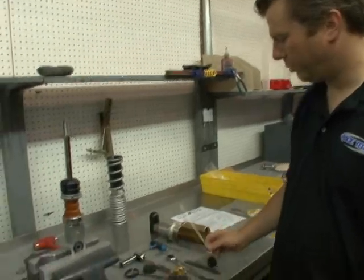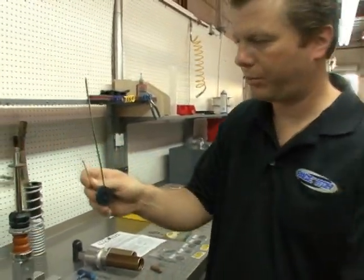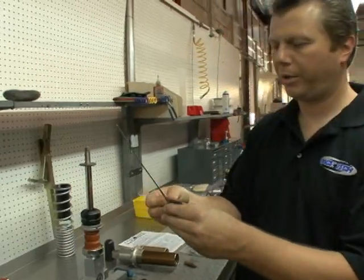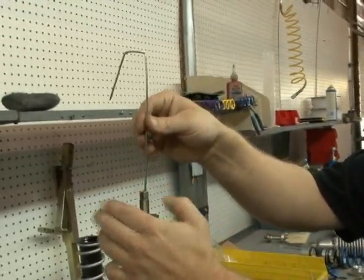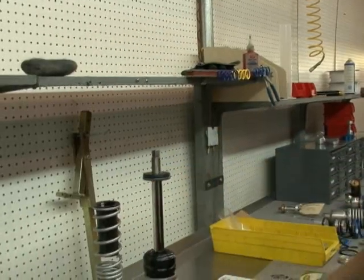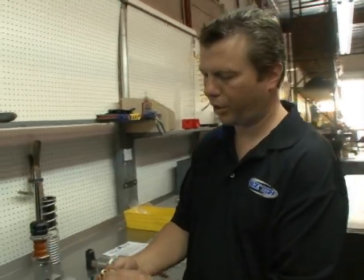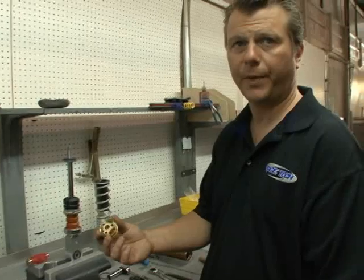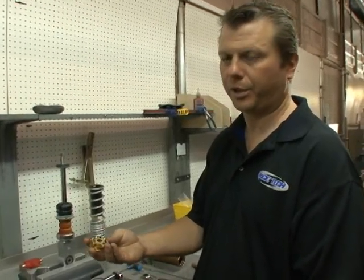At this point we'll assume we've built our valve stacks. We'll use the stock ones for comparison's sake, and drop it back on the shaft. From there, make sure the piston is surfaced. Surfacing pistons is something we do on a rebuild or a new build — anytime I take a shock apart, I'll surface the piston. We'll use anything from 600 grit; you can use 240 grit for surfacing a piston. If you don't have a surface plate, a piece of glass works just fine.